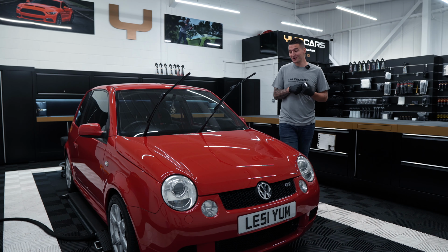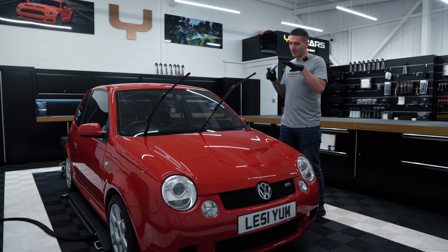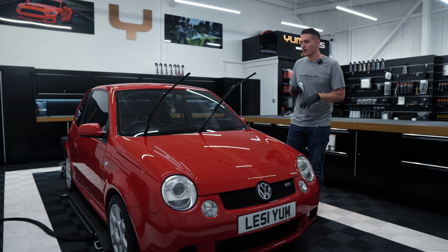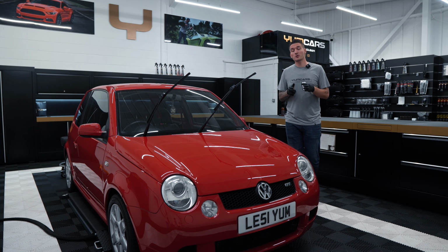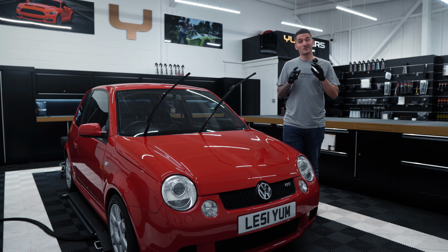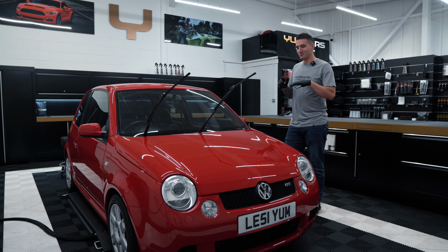All right, friends, so we're coming to the final few stages of the car. I didn't film the previous step, which was to completely panel wipe the car down. So basically what you saw is my development panel wipe. What I've done is I went around the car, the glass, everything. So everything that has been touched with polish, a compound, anything like that, anything that could have potential oil residue left, has been panel wiped, which of course has been the whole car. So now it's ready.